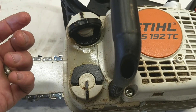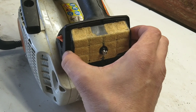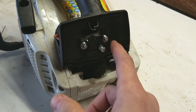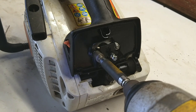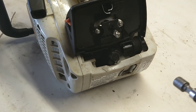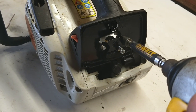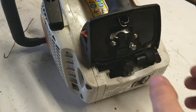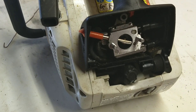So I'm going to take the back off and we're going to take a look at the carburetor. We'll loosen the air filter cover and pop off the air filter. There are two 8mm bolts or 5/16ths — they're actually nuts, not bolts — so we'll take those off. I'm going to take mine off with the impact. When I put it back on I'll use a hand wrench because you don't want to over-tighten those and break something. Then we can take this cover off and get down into the carburetor.